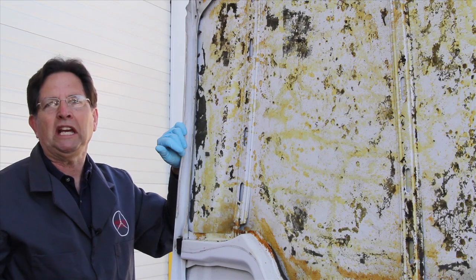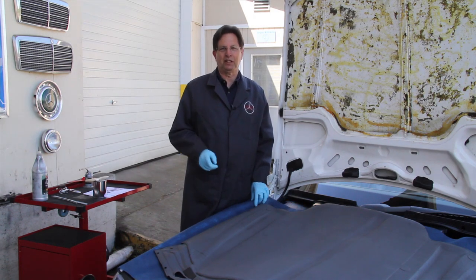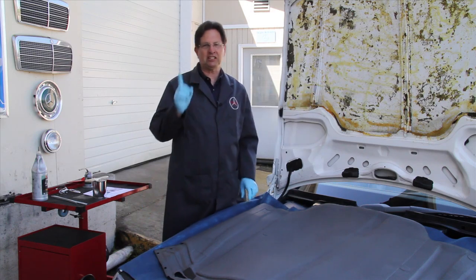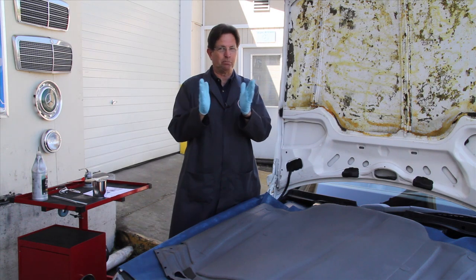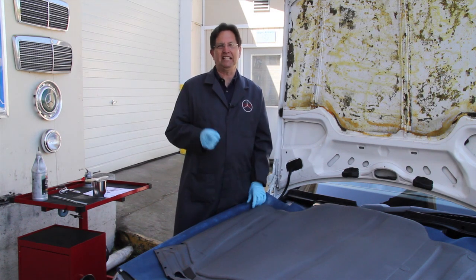I'm going to show you some of the things we do to prevent this problem with our hood kits that we sell on our website. I've installed a lot of hood pads over the years and not all of them have been successful. I learned very quickly that not all glue is created equal. In fact, there are very few types of glues that really work well when installing a hood pad onto the inside of a steel hood. Number one, it has to be a contact adhesive — which means you put the glue on both sides and when you put it together it sticks. That creates a problem because if your hood pad isn't lined up properly, if you try to get it off you're probably going to tear it. The glue itself is the number one thing you need to be concerned about — if you don't use the right glue, that hood pad is going to fall off in a few years.